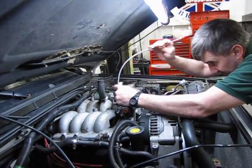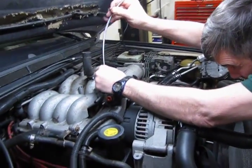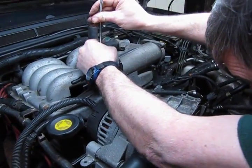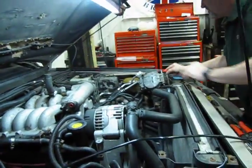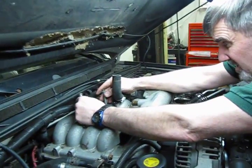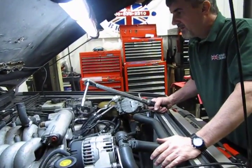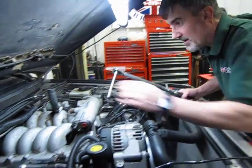Same with the front. You can actually watch the front right underneath the beginning of the intake. You have an open valley, and we can see that run down. So that's run a few threads and it's good. And then the 4 tall bolts in the middle. Okay, so we have our 6 bolts started. The book shows that we're going to torque these to 18 foot-pounds.